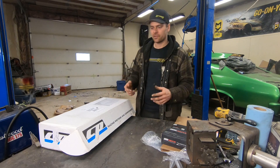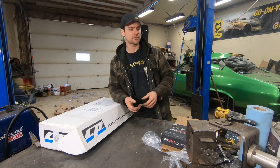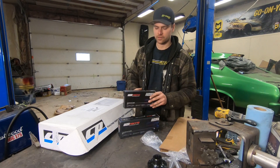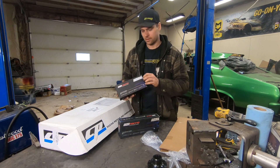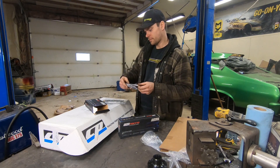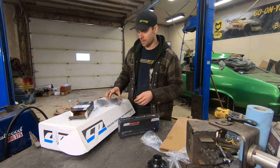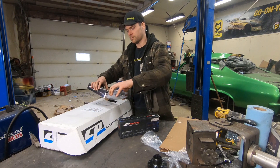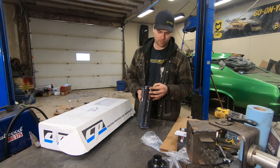So I figured I'd just go through a quick video of some stuff that showed up — parts that are gonna end up going into the new engine when we build it. We're doing King Racing bearings for rods and mains. King told me what to order when I talked to them, so we got the P-max coating on our King bearings. Last year we were just using the bi-metals, but I'm pretty sure these are tri-metal now with their black coating.